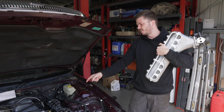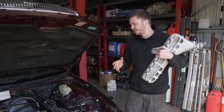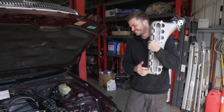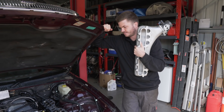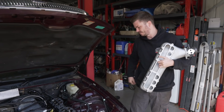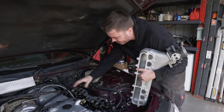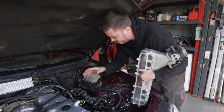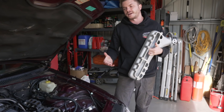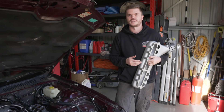We're going to have a crack at bolting the plenum on for the first time, which means taking the manifold off the bottom half because the bolts now come from underneath. Nathan also wants to clean up the engine bay — remove the battery tray, move the catch can, ditch the accelerator cable and cruise control. We also want to redesign the coil pack tray, but since we already have a wiring harness made up, we'll find a simple solution rather than redesigning the wheel.